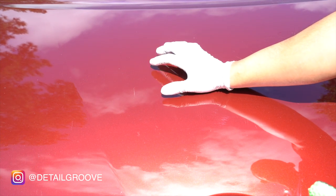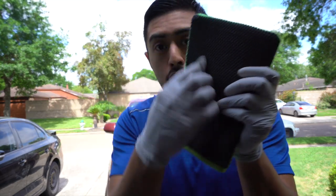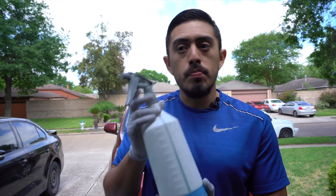You should really think about this more if you're not going to polish the paint. Because if you're not going to polish afterwards, and maybe you did add a little bit of haze, and maybe there are imprints you can clearly see — literally the pattern of the pad left on the paint — it's going to be quite easy for you to see, and maybe not so much for the customer. But why put yourself in a situation where they're going to see those weird blemishes and ask what's going on? The point is: you want the surface lubricated when it's hot. Maybe you don't want to go with just clay lube — maybe you actually want to dunk it into a wash bucket with clean soap and water to make sure it's always going to stay lubricated.